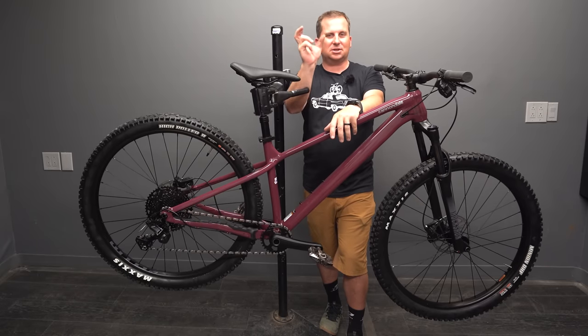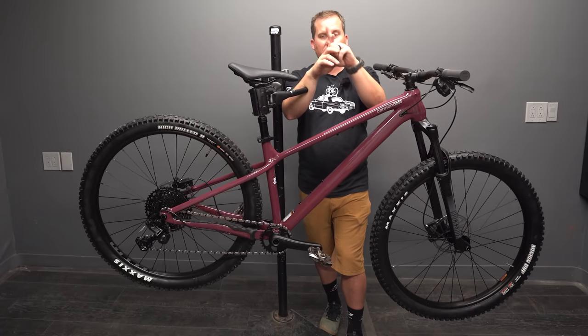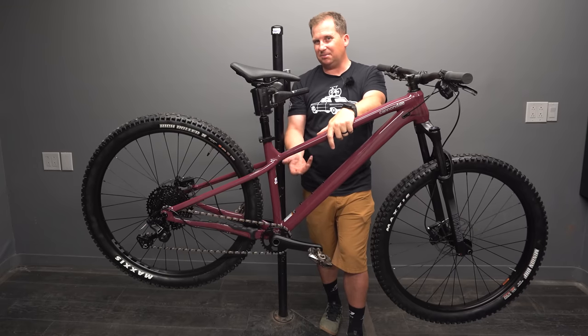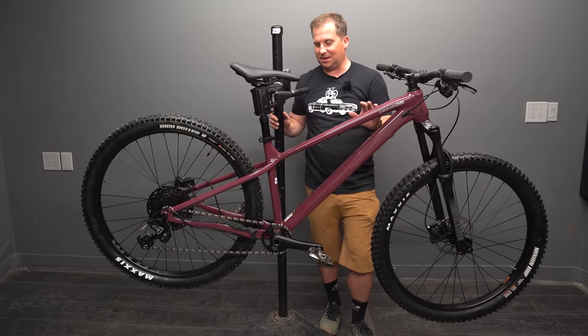It's that little plastic, just like in the 90s, those plastic guides where the cables come through and then it feeds them the way they want to go. Makes for a pretty tidy setup, but I don't know. I just think that Phillips head is the wrong way to do that. Nobody should be using Phillips heads on bikes anymore.